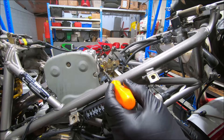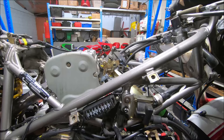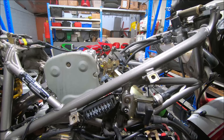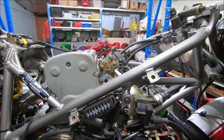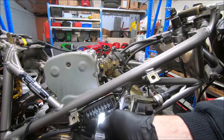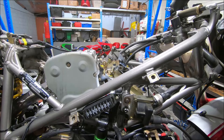If you want to adjust how much effect this has, where this cam here runs on this lever, then you undo these screws and you slide the whole mechanism towards the front, and that will open it more. I think I'm going to have to do that realistically, because you're really not getting a great deal of opening. It's probably got enough opening to do what it needs to do, so I'll leave it as it is. It's easier to not adjust these things.